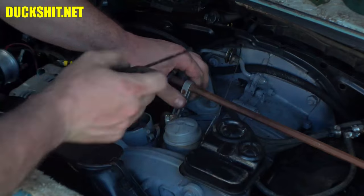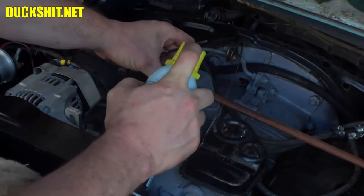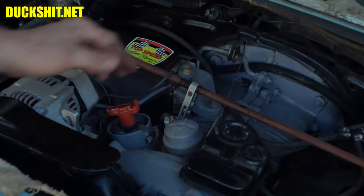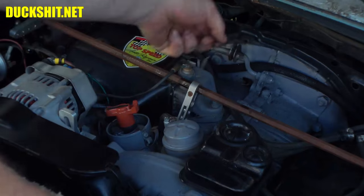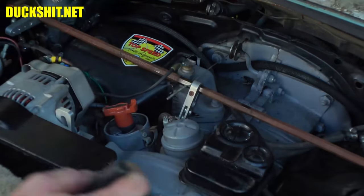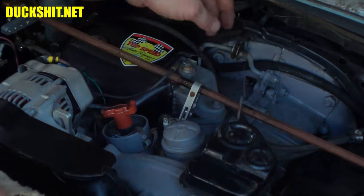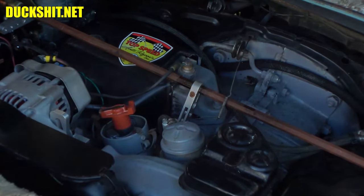I think the arm needs to be over here instead of where it was, because you can see that pulley behind it is at an angle — the throttle cable would be pulling on a slight diagonal. It was off by about three-quarters of an inch to the left in my opinion. Looking at the top of the oil cooler, I can see wear marks where the throttle cable was rubbing on it. So this is a better solution — it's going to fit a whole lot better and should be a little easier to get some of the slack out too.